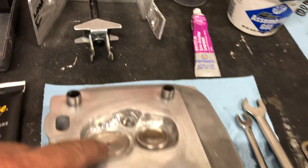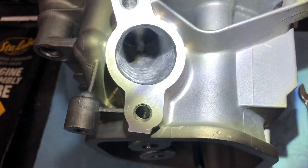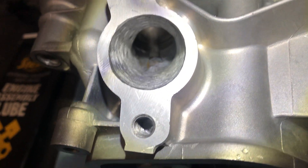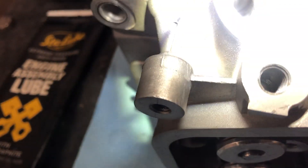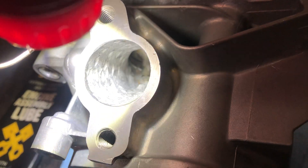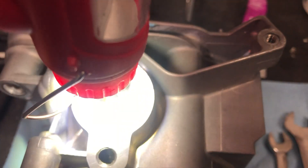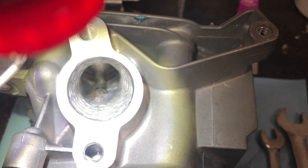So we lapped the valves in and rounded the edges. On the last video I talked about what I did inside the port. You can see one side of the port is higher and one side is lower. We did some pretty crazy stuff in there - we made all those dimples in there to help keep some turbulence going and prevent the fuel from dropping out. You can also do the same thing with an epoxy texture - not to build up the port at all, but just enough to create a texture that will keep the air rolling and keep some turbulence.